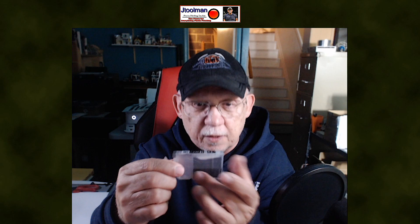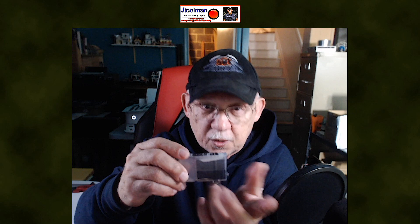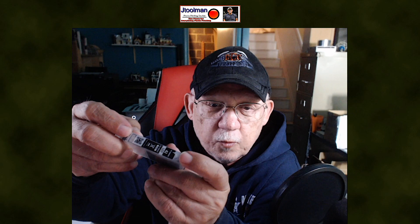We would watch the sponge absorb the ink, and as you can see it doesn't really go all the way to the top. We would allow the sponge to saturate — you'll see the ink levels drop as ink is being transported over to the sponge side. There's a little tiny hole underneath here that allows the ink to permeate the sponge. This ink is entering on the lower level — there are actually two layers — and it goes to the top. Because we basically opened up this chamber it's going to fill all the way to the top. You do not want it to go beyond that vent area, which is right here underneath — this is the vent you open up when you remove that tab initially.